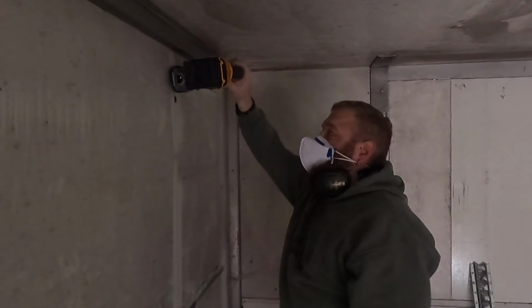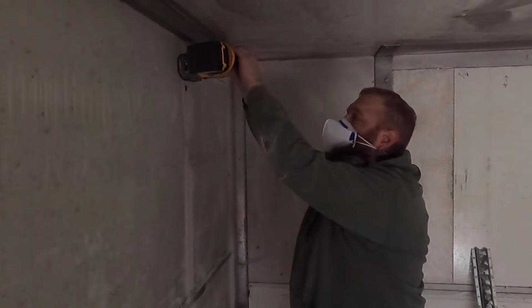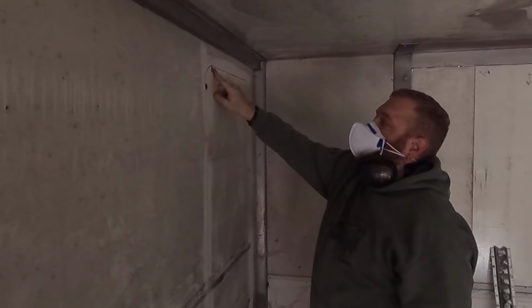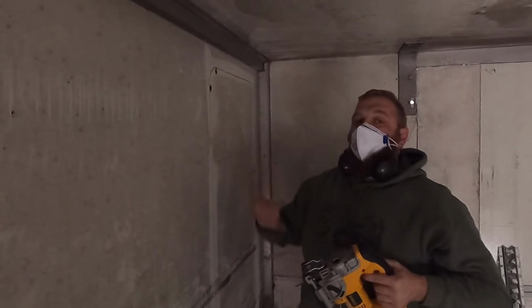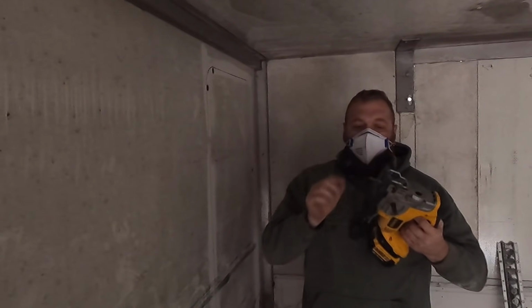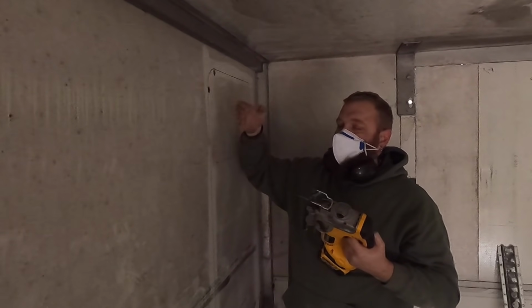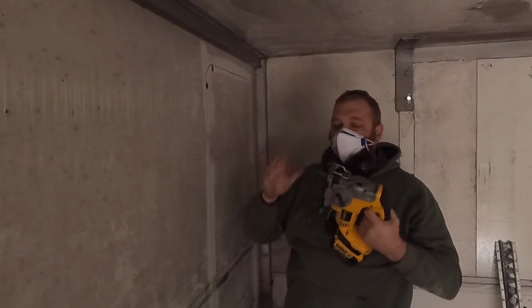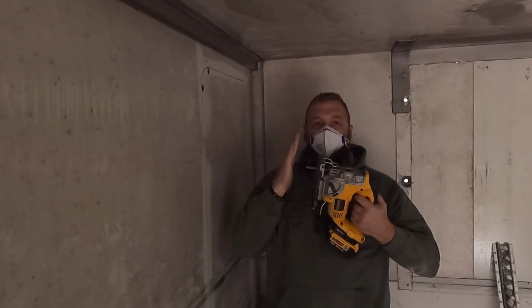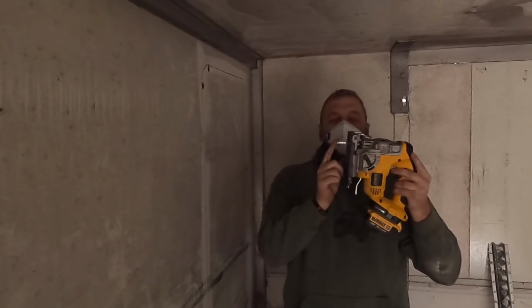I'm cutting big holes in an expensive thing. So now what I'm doing, I put the hole saw on either angle, it gives room to get the saw in. Someone's going to say, why are you cutting on a spazzy angle? Reason is, because it's fiberglass wood, insulation wood fiberglass, the blade would bang up against the other piece of wood. So what we're having to do is angle it so the blade isn't at full depth.